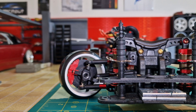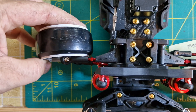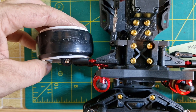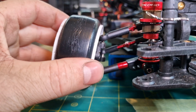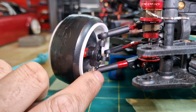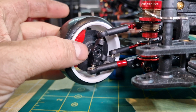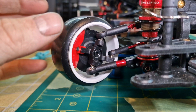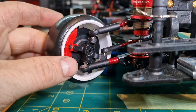That braking effect can lead to spinning out at full lock. We can see here — if I put pressure on the wheel — that's the actual hub flexing, allowing the wheel to come into contact with the upper arm and also with the chassis. Up on the chassis stand we can see that at full droop we have contact with the lower nub that sticks out of the hub, and also the connecting point for the steering rack makes contact with that lower arm.